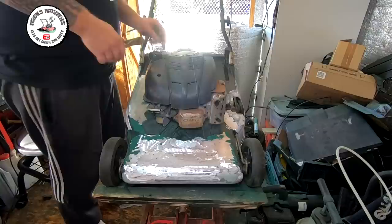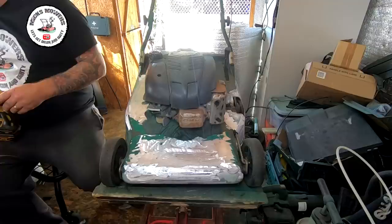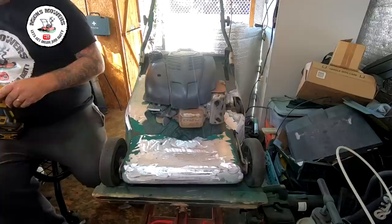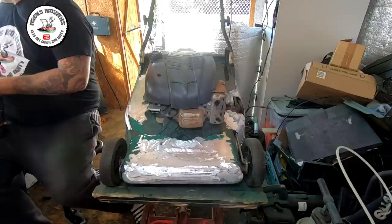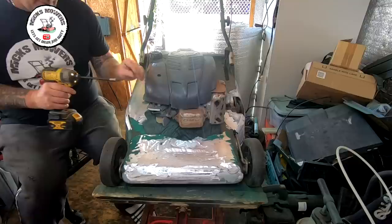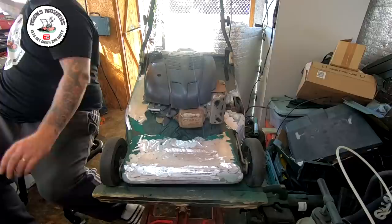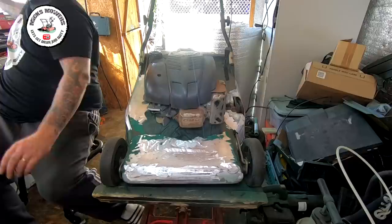Engine's now unbolted. I'm going to cut this cord here because it needs to be changed anyway — there's a little tiny metal bit there which we can keep. All I need to do is disconnect the throttle off of this machine. There's a 14mm in there and I need a 10mm to go back on. I've got the little tiny spring that goes onto the carburettor to make sure the machine fully chokes. I've got one off a donor engine outside — I'll show you that in two ticks, because that's what's missing on this machine to allow it to fully choke.